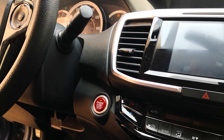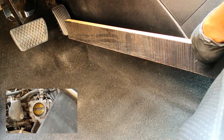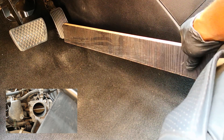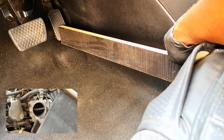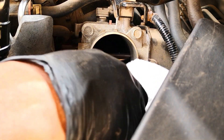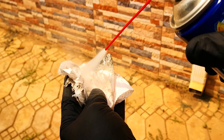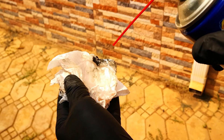What you can do is turn on the ignition and have an assistant depress the gas pedal for you. Since I don't have an assistant, I'm just going to put this wood here and then use the seat to ensure that the pedal is fully depressed. With that open, you can spray on the butterfly plate and then wipe down. You can also spray the carb cleaner directly on the paper towel.